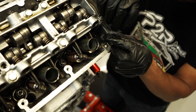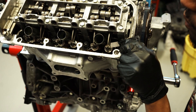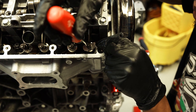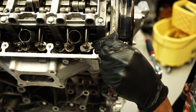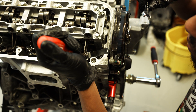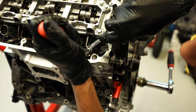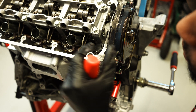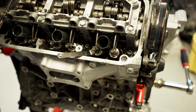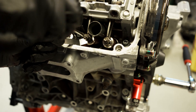We're going to go ahead and do the same thing on the exhaust side. However, for the exhaust we're going to do 0.012. Basically the same thing — I had all the adjustment screws screwed all the way out so I'm starting from a clean slate. I'm using the flathead and just getting it to where it feels what I expect: a slight amount of drag. While you're doing that, go ahead and tighten up the screw a little bit. Once you do that, feel it out one more time. If it's too loose, loosen it and start again. If it's too tight, do the same thing.